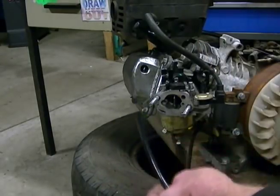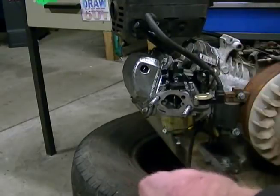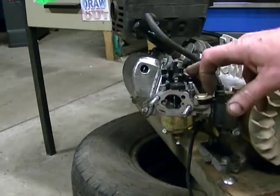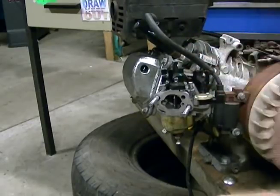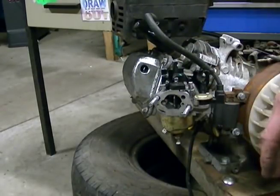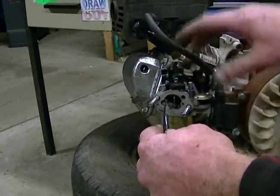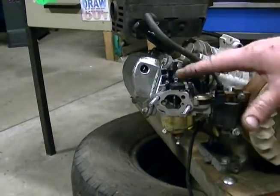Just putting the delivery line of your HHO into the back of the carburettor is not going to do you any favours. You're not going to reduce the amount of fuel that the motor draws through the carburettor, because it's going to draw the same amount of gas through that carburettor, thus drawing up the same amount of fuel through the venturi. The only difference is now you've got a bit of HHO gas in there. You're basically taking a fuel, putting it in your carburettor, and dumping it straight on top of the fuel-air mix already being delivered to the motor — you're just adding more fuel. We don't want to add more fuel, we want to reduce the fuel.